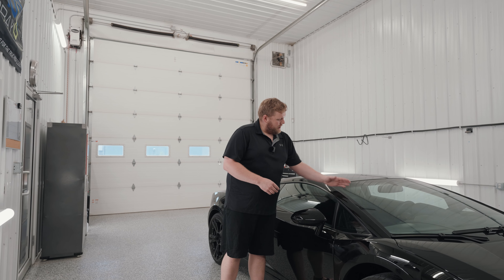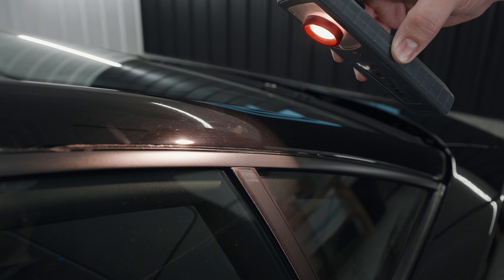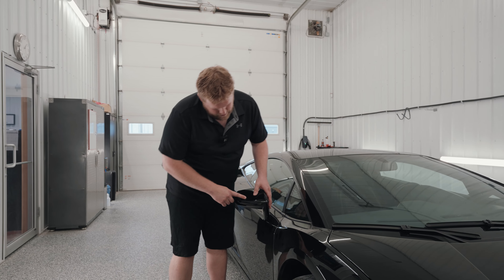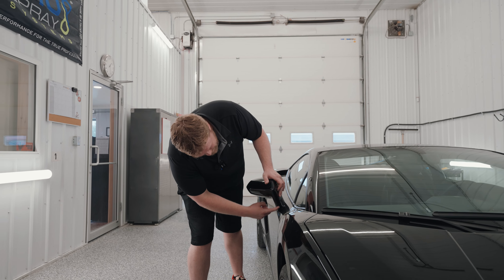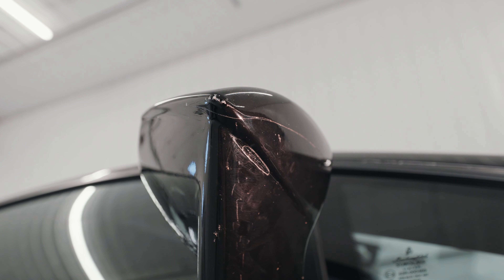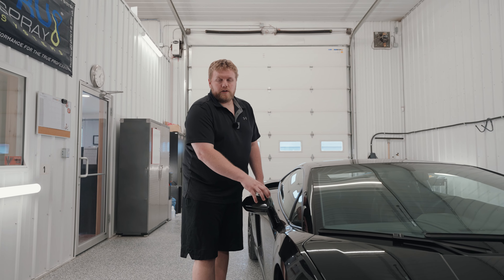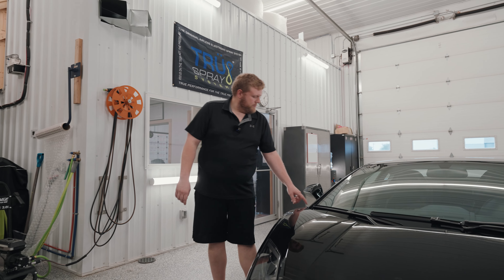The A-pillars are covered in PPF right up until the top of the glass. You can see there's all kinds of dirt and debris underneath the film, including moisture bubbles. The mirrors are a two-piece installation — this bottom piece is not wrapped, the top piece is wrapped, and the very top mirror cap is wrapped, but there are all kinds of fingers popping up here that are peeling. These I will remove and replace because this is still original factory paint underneath. The front fenders are installed well, but the wrapped edges around the corners are lifting up.